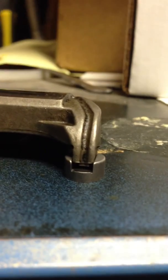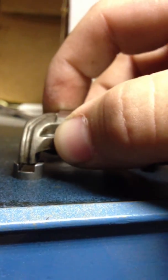You can see here the factory guide fits very nicely on the left arm — the right arm the way I'm facing it. On this side, the one that is normally flat does not fit at all. It's a known issue where people get their guides and shims mixed up, and they try to put one on this side with a flat one on the other side, then torque the cams down and snap the guide in half because it doesn't fit.